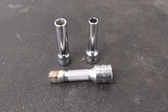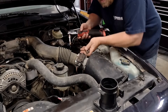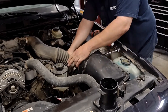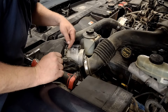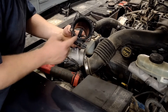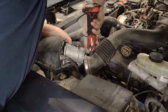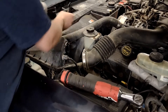All you need for tools to do this is an 8mm and a 10mm. The 8mm takes your hose clamp off for your inlet duct, and the 10mm takes the bolts out of your air filter housing. To take the mass airflow sensor itself off, you can see there are four screws — one on each corner — that correspond with these holes. Note the offset on this; you want to make sure you put it back in the right way. A little extension helps you get around the body. Four screws out — there's a little gasket to it, keep that.